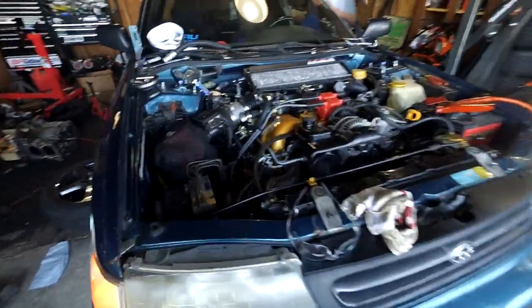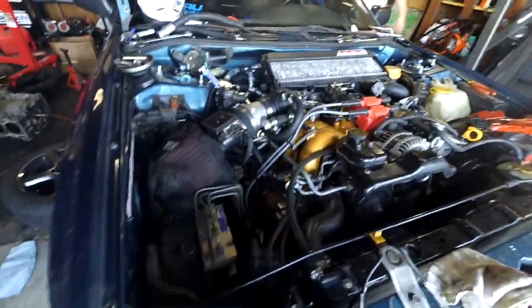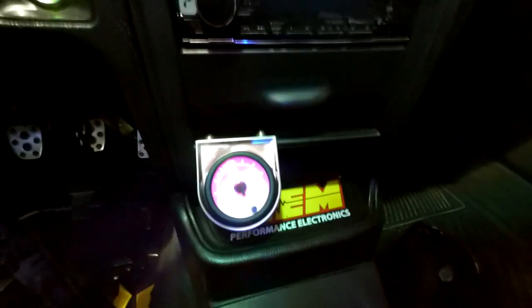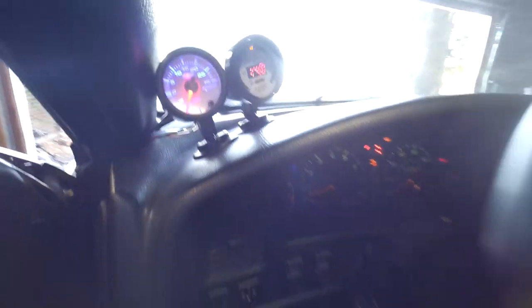It's got 90 psi of oil pressure. So everything's working great. It actually sounds really good. It's almost already up to operating temp. We got the tie rods and everything kind of situated. First thing is to take it to get an alignment, but air fuels are perfect. She's warming up nicely. The oil pressure is going down like it should as it warms up. It's about 60 psi now. Plenty of vacuum, as you guys can see. And damn, it sounds awesome.